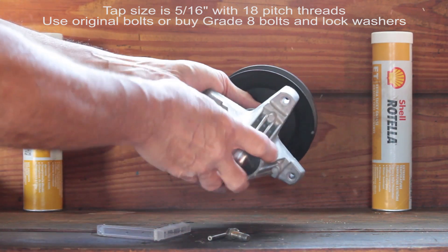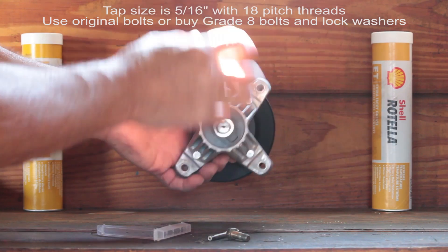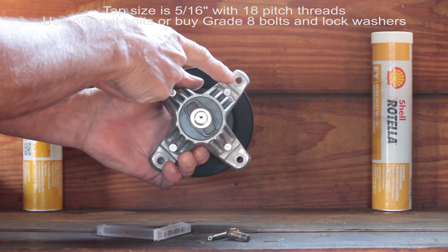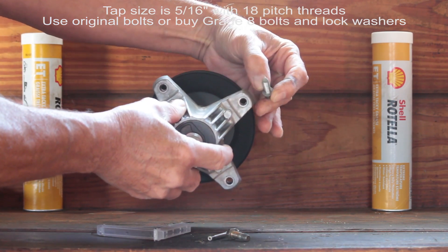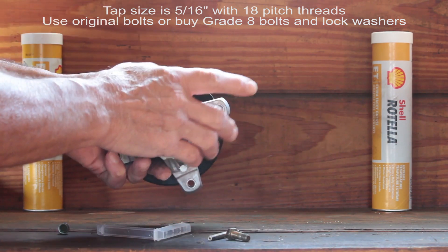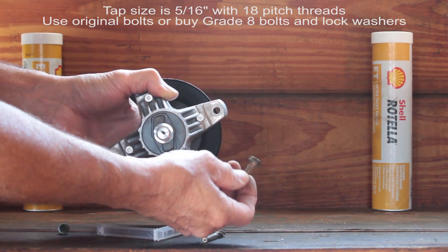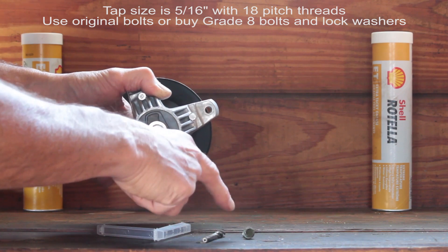Here's what you get when you order your brand new Cub Cadet replacement spindle with pulley — it is a complete unit with obviously the proprietary blade mount. What people find is that these are not tapped for the existing bolts. These existing bolts here have kind of a triangle shape to them — they're probably a self-tapper. So what I do with these is I have a spiral tap — it's a 5/16 by 18 thread, which is similar to the exact same thread. There's also an M8 metric that is similar to this too.